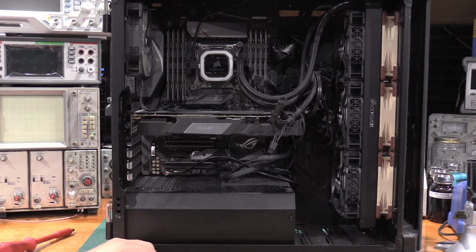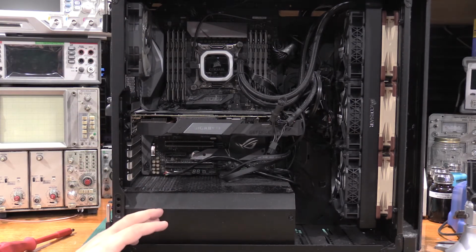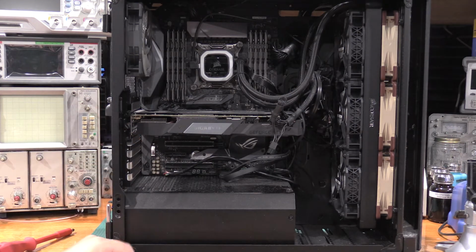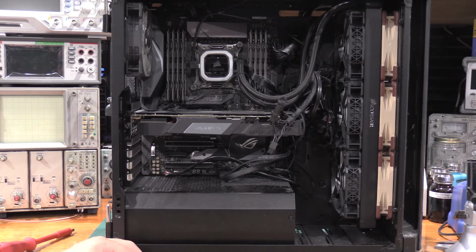This was put together at about 12 o'clock at night, and I needed this the next day, so I did not have much time. Once it booted up and posted, that was what I needed. I was also kind of panicking because this one and my gaming computer shared some parts, and neither one of them was working, and it was just a bad day in the lab. It ended up being a random FireWire PCI card that was preventing the computers from booting. The motherboard didn't like that specific card. I kept the FireWire card for an M-Audio 2626 preamp that I ended up not using because the FireWire card doesn't work. So let me, actually, that radiator looks pretty clean.